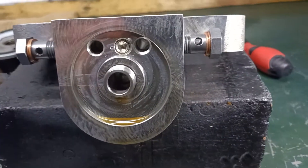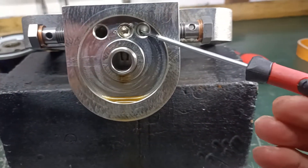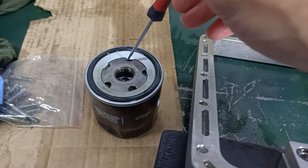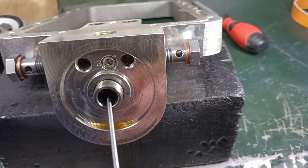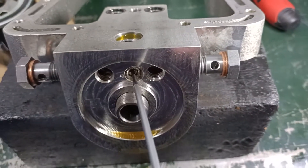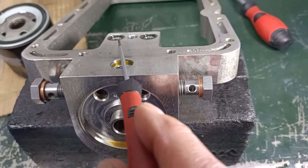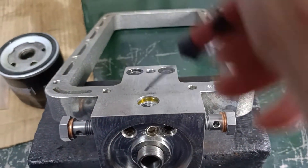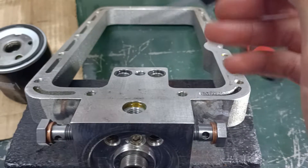What should happen is oil from the oil pump goes down there, goes through a drilling to the right-hand bolt, comes out of there, normally around the oil filter, in through one of these holes, through the filter, out the middle, through there, up through a drilling in the casting — which is that one, it's at a slight angle and it faces that way.